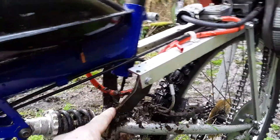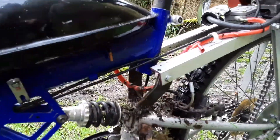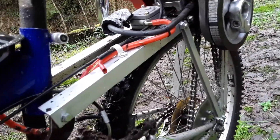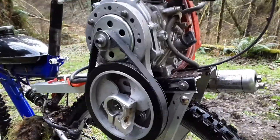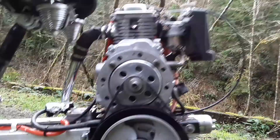The way I did it — kind of the key was — I made this metal bracket here out of flat bar, and I welded it. This is a metal swing arm. I think the frame might have been aluminum, maybe not, might be steel. I welded this bracket to fit the same width as the motor plate, and to reach down and weld to the top of the swing arm. That allowed me to put these pieces of angle bracket that I got at the hardware store — angle aluminum — under the motor plate, and then just mounted everything together, kind of squared it all off.